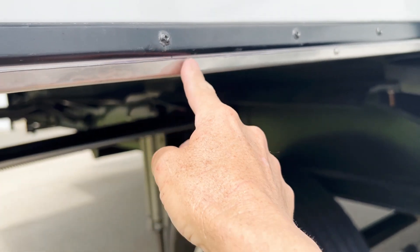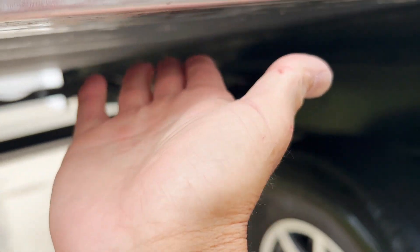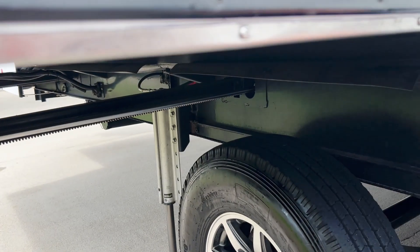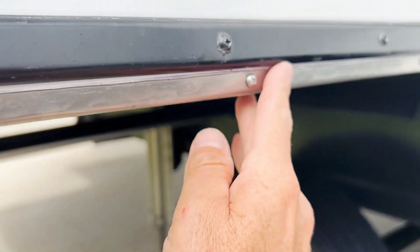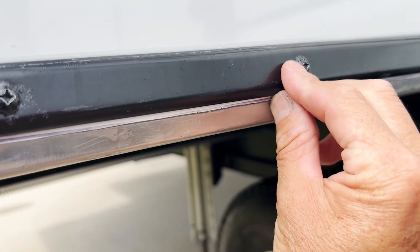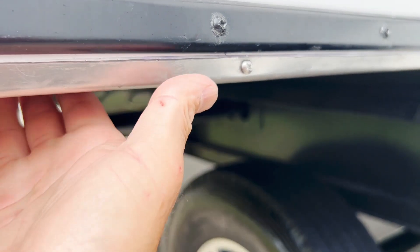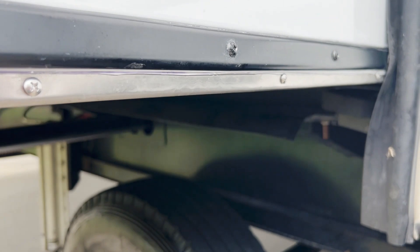What these screws do is help keep this slide ski in place if your construction adhesive that's under here fails over time — it keeps the slide ski from coming out or coming down and damaging your flooring on the inside, damaging your wall, or something like that. It's just additional insurance. The metal bar and the existing screws are already doing some holding, but these additional screws are extra insurance. You want that with metal skis because if your construction adhesive fails, they're not going to break like a plastic ski will — they're going to do some serious damage if they get out of place.